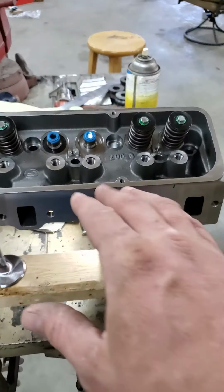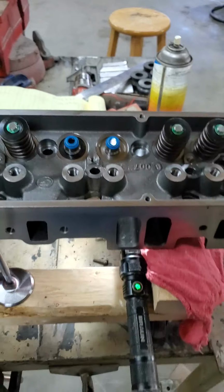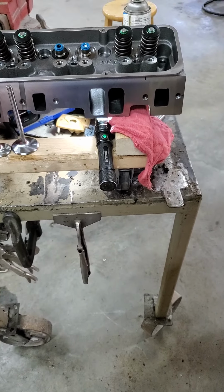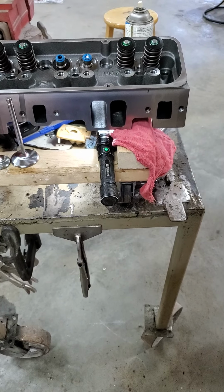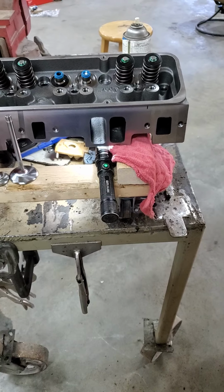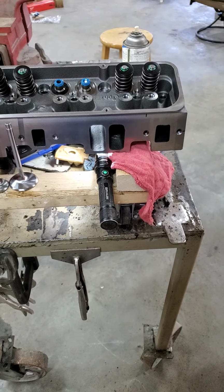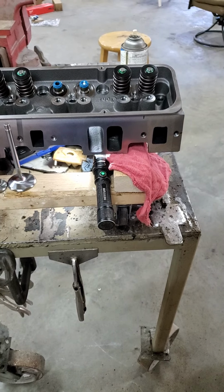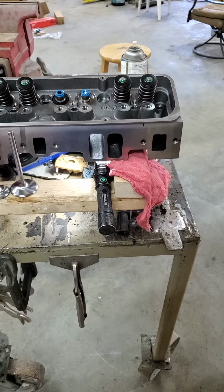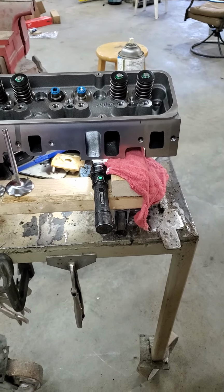One change that they've made is they've gone to a PC type seal, or what I call a PC seal. That was a problem I had on mine, the valve seals leaked from the time it was new. I can't remember what they used, but they didn't use that. That thing would smoke a little bit at an idle, and going down the road at real steady state, high vacuum situations, it would smoke a little bit, and I know that's what it was. There was nothing I could do about it because the guy needed a machine down to put that kind of seal on.